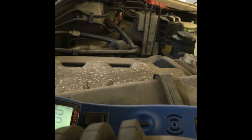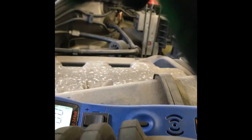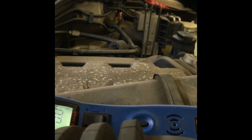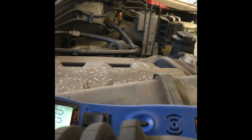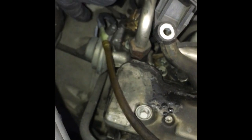The only other thing we can really do to test it is hook our vacuum line up to the port where it goes into the EGR valve and drive it to make sure it gets a signal from the PCM to turn the vacuum switch on. So the last final test is to plug our electrical connector back in, unplug the EGR valve vacuum port, and plug in our vacuum gauge tester like so.